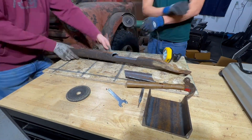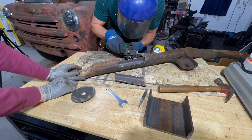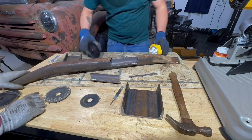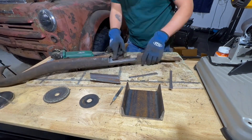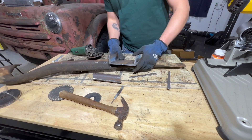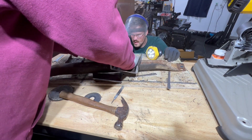An important step that we haven't mentioned yet: before you pull your transmission crossmember, crawl under your car and mark where a good spot for this cutout should go. Definitely right here.